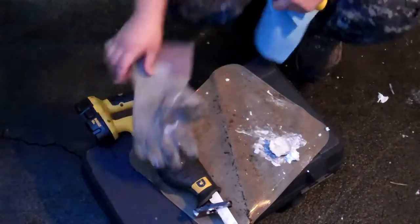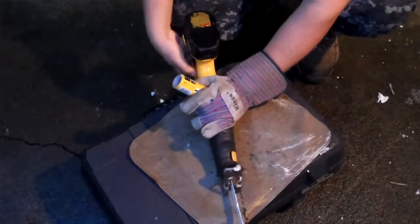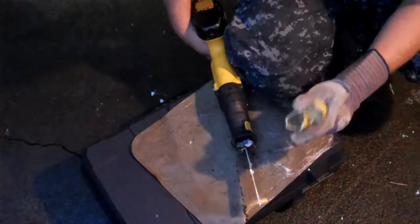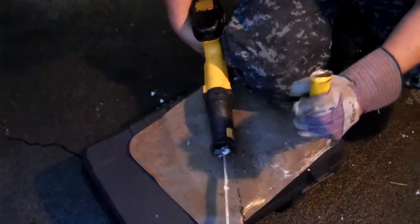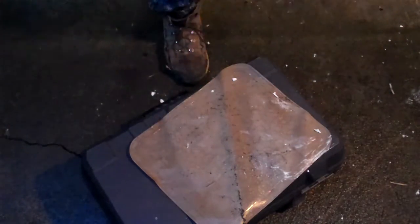I'm going to go ahead and grab my glove and cut into this one. I'm going to do this one a little bit differently because the can is smaller. Nice little tearing action there. As you can see, I really like these Sawzall blades — they're called the Torch for a reason. We're going to want to clean up these edges a little bit; it's a little smashed and jagged. We probably don't want that floating around inside the engine. What I do here is fold it over on itself a little bit, just make a little lip. The best part is it has this cool thing that says 'butane fuel' — so people will know exactly where I got this radiator hose from. Just demonstrates that if you're on the side of the road and need to fix your radiator hose, this is one of the ways it's possible to do it.